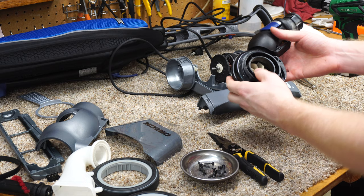After you clean your brush roller, it's time to put it back on. The belt should not need to be replaced — it should be good to go for a very long time. The rollers have a flat side; they're both the same, unlike previous Orecks. What we're going to do is put one side in partially, put the belt on, then push the roller into place. The roller should spin freely and the belt should be fairly centered, not rubbing on anything. After the belt is installed, we can do the other cover — make sure it's in the unlocked position when you do that.